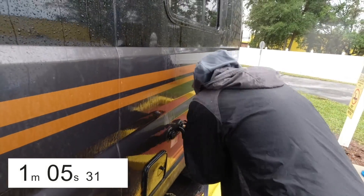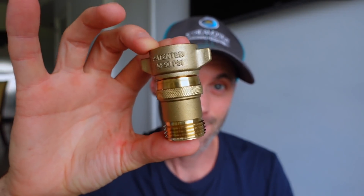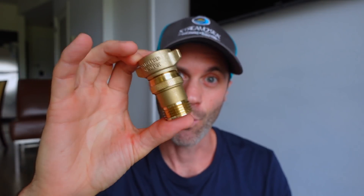So first up let's talk about water. Specifically you need to find a way to safely transport that water into the van and keep it sanitized and fresh. You'll need one of these — just a basic hose that is fresh water rated, so it's safe for potable water, and ideally one that's BPA free. This is one of the most common ones you'll find at an RV store. Next up you'll need a water pressure regulator, and what this does is slow down the water flow so it doesn't damage your fresh water system with pressure that's too high.